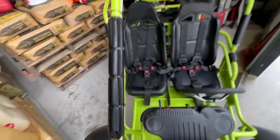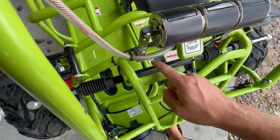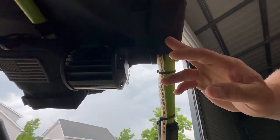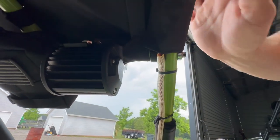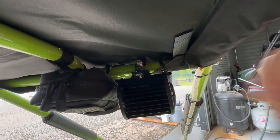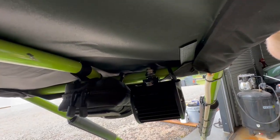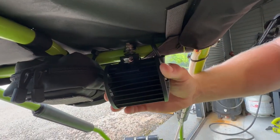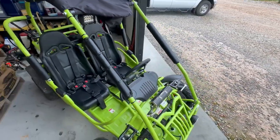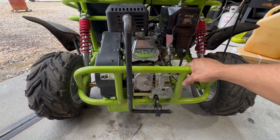The stock lights I have aimed about six feet out, centered. The new light acts like a floodlight, illuminating the entire area in front of you. For the wiring, I ran the wire inside a piece of plastic tubing I had in my shop, tucked it into the canopy that came with the go-kart, and used butt splices — soldering is normally better but butt splices are fine here. I used clamps that came off the pallet and literally just bolted everything in place. The one thing to note is that as an adult getting into the passenger side, you will bump your head on that light if you're not paying attention.